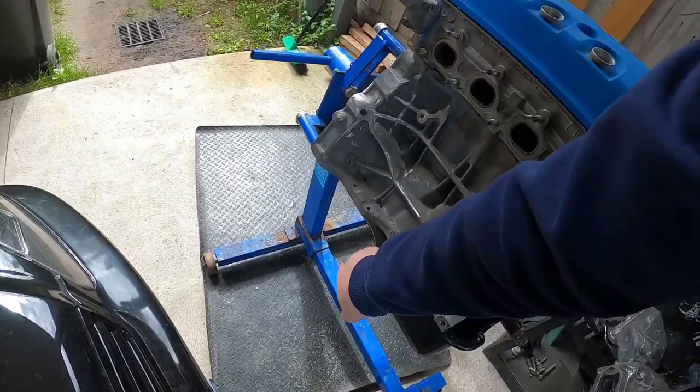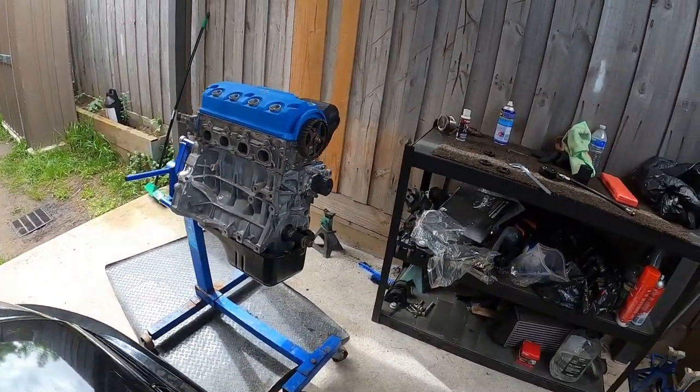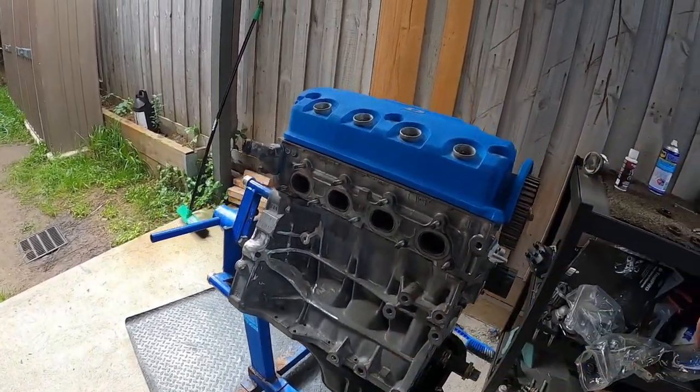I've got to take this down to Trick Fab and get them to weld a bung on there. I'm not going to do the drill through one on this one, since it's off the car and I've got time. I'll get a proper one welded on there. The reason why it took me so long was because I was using a cordless drill and a carbide burr to bore out the bottom of the cylinders so that the rods would clear, and also to clearance things on the girdle. So I kept sending the batteries dead and having to wait to charge those up, so it took days.